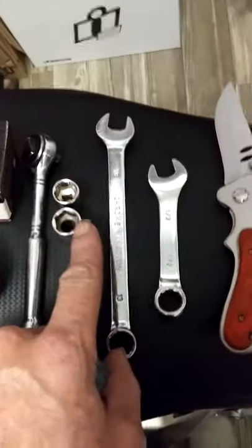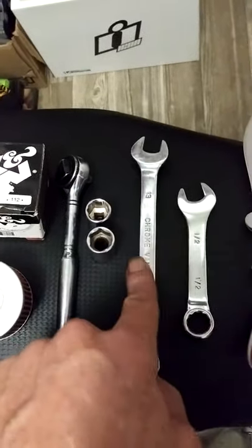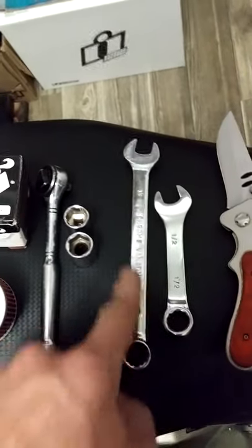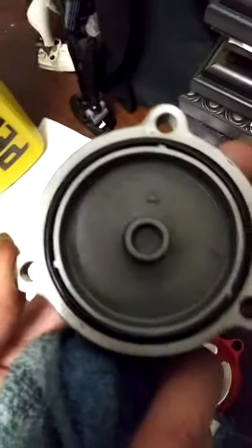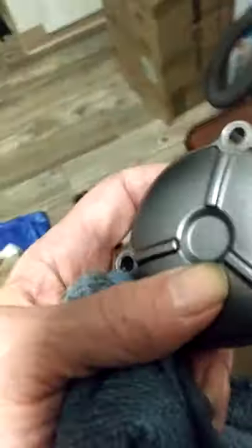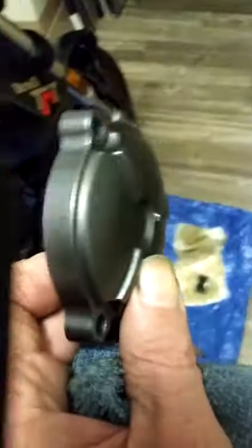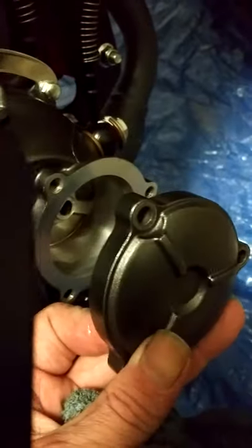You're going to need the small ratchet — a 13mm. If you don't have a 13 and you're desperate, maybe get a combination wrench of 13, or a half if you're desperate. You're also going to need a knife, a sharp blade — that's going to take out the cap gasket or o-ring. If you notice that arrow pointing up, that means your cap is going to go with that hole pointing up when installed, just like that. That's the arrow — up.